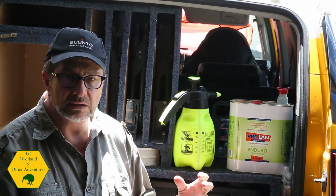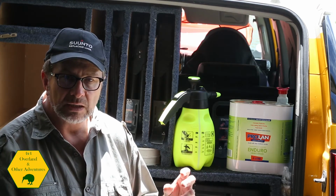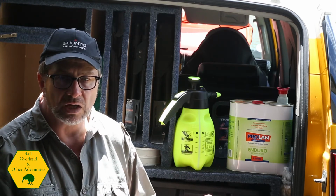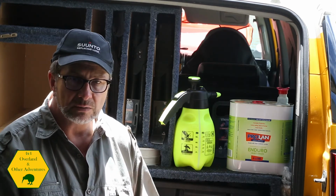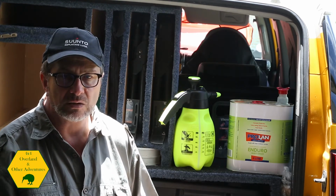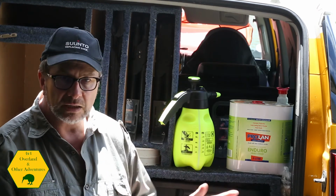Then what I did, underneath the vehicle, which I'll show you in a moment, any bit of chassis that's got a hole in, I sprayed inside the hole. I filled everything. So before this, I took a hose and I washed out the chassis. I washed everything I could underneath the car, and then I sprayed it.